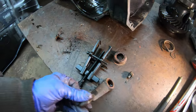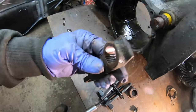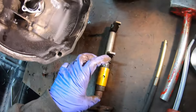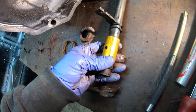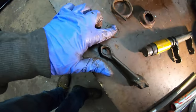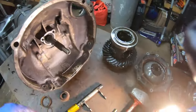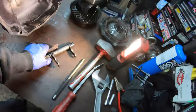I got the clutch arm off — it has four splines underneath, so I had to use the little puller to pull that off. There was a snap ring on the end, and I've also taken the snap ring on the inside, so we're going to go ahead and remove the shaft completely. It was a matter of just wiggling it in and out, and then the shaft came out through the inside of the case. There's a brass bushing here, and a snap ring on the inside that locks it into the end of the case. On the outside you have the arm, the snap ring, the spring, and there's a throw bearing that rides on the guide tube, which I already removed. There's also a little bolt here that sits into the hole on the bushing to ensure the bushing doesn't spin in the case — super simple setup.